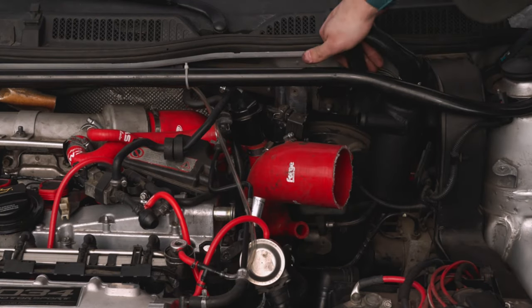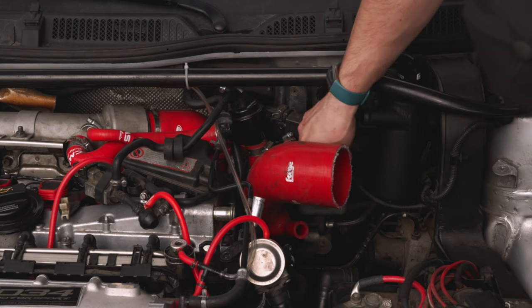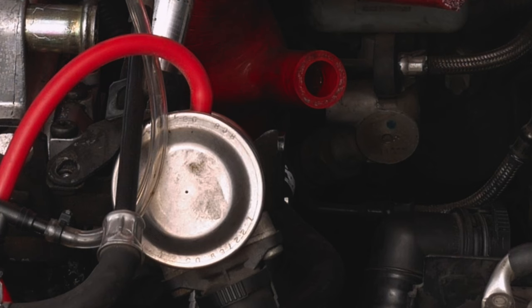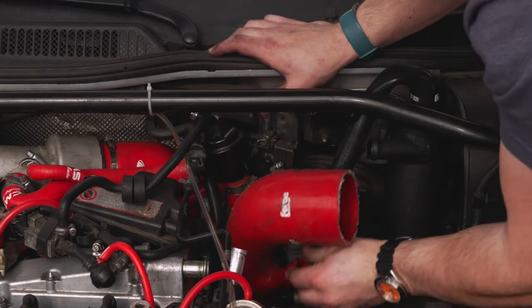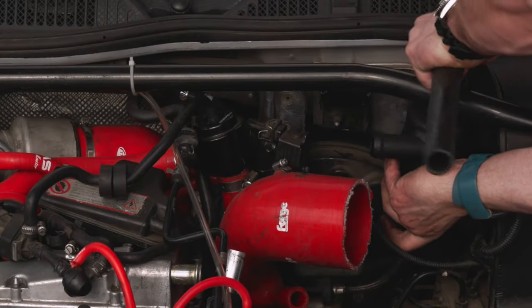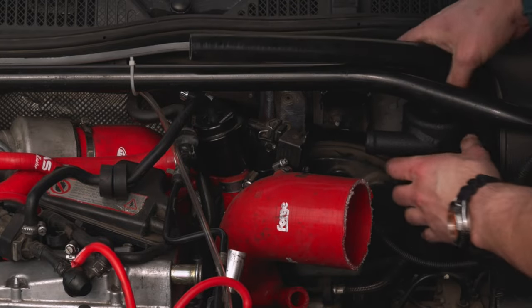This hose has simply a 90-degree bend. On the platform this hose was designed for, it fits by routing directly over here. That's not where it needs to go on the 225 — on the 225 it needs to go down here. Since the silicone hose was originally formed with only a 90-degree bend, if we bend it any more it's completely kinked and shut at the top. So while it's long enough, it's not going to work. We're going to need to think a bit outside the box.